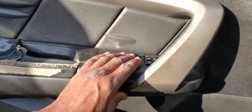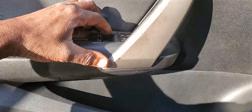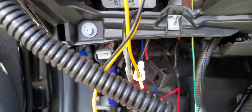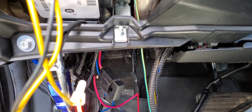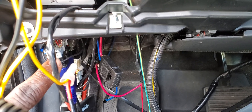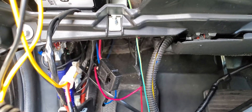This master switch also gets fed by it. With the ignition on, the ignition is working now. But it's also feeding that — maybe the power is reaching there but being cut somewhere. Also the driver door courtesy light — where you hear pip, pip, pip — it also feeds the immobilizer keyless system, the keyless control unit, the power window, driver door courtesy light, front passenger door, the gauge control module, the DLC, and also the handset link for phones.